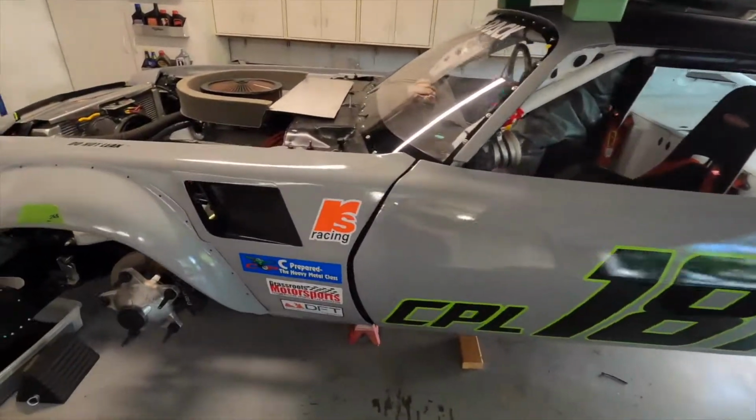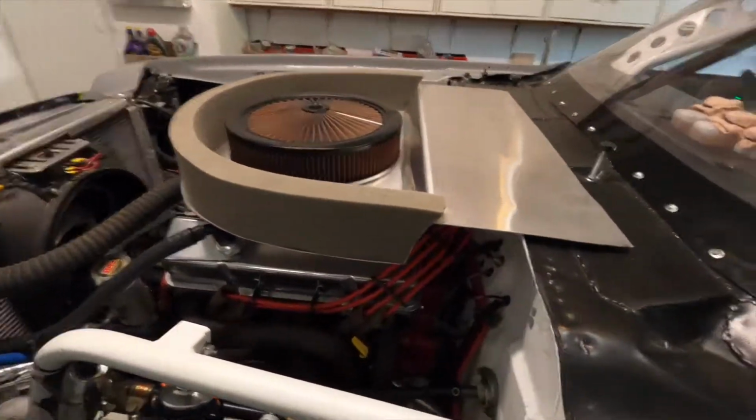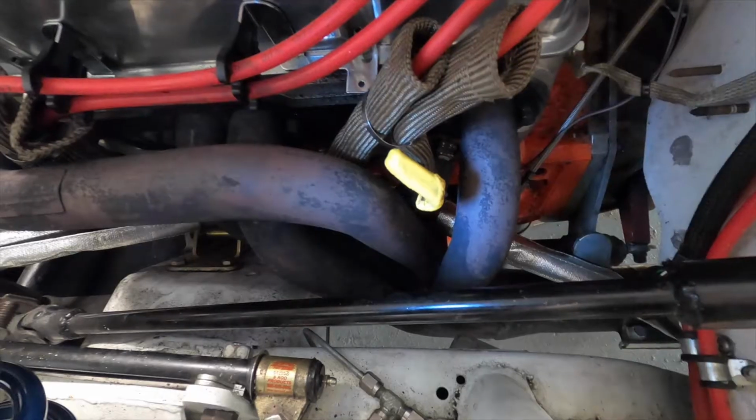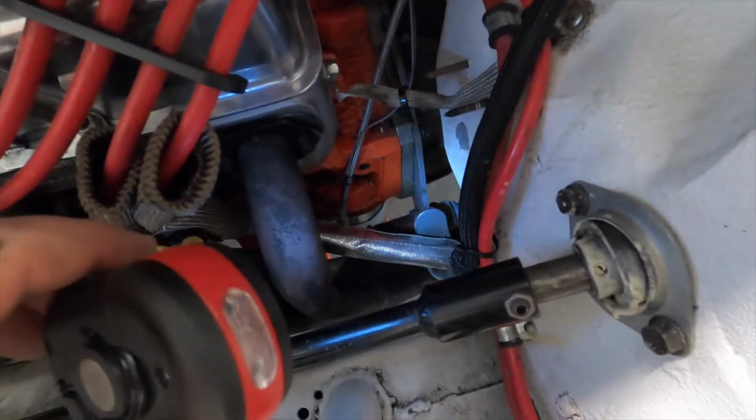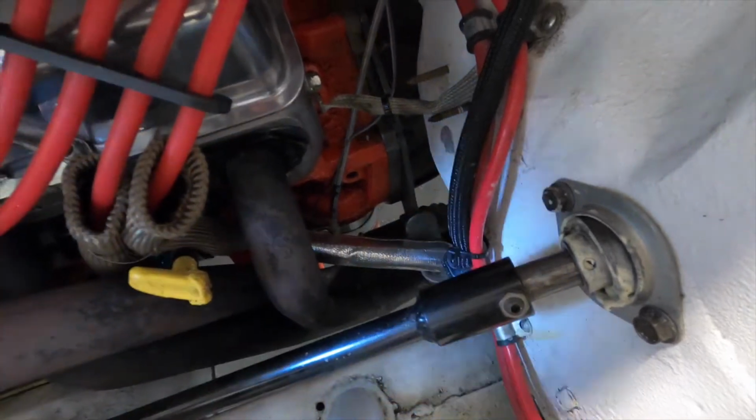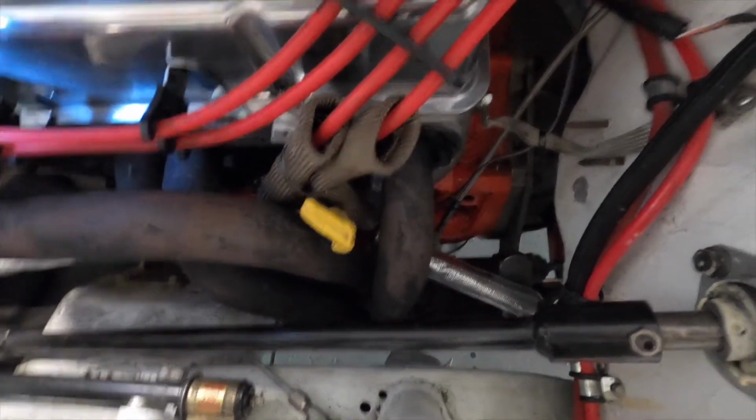All right, the Accusump is in, and that sucked. You're not going to be able to see anything. Let me get a flashlight. Well, you're not going to be able to see anything, but there is a whole mess of adapters and hoses. This one wrapped in the silver line there, that's the feed to the Accusump. That's the one that was giving me the most hassle. It was leaking. It was just hard to get in there to tighten it up. But I think I got it tight.